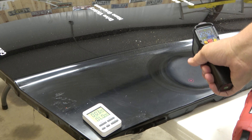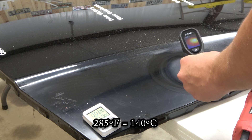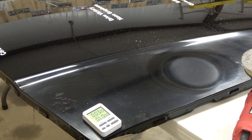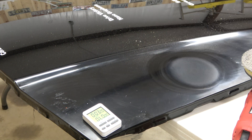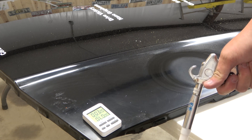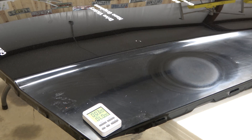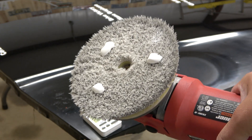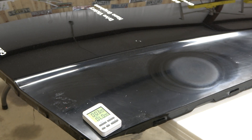At a minute and a half the pad is smoking and reading 285 degrees. The other gauge says 277. It is smoking — you can smell it. I think it's the product breaking down from the heat. The hood just popped from the heat expansion and contraction. A lot of what you're seeing is the product on the pad lubricating the surface until it breaks down from the heat, then starting to bake itself onto the surface.